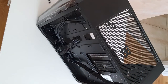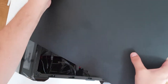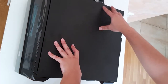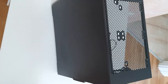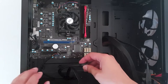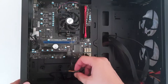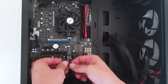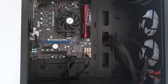Let me know in the comments if you can see anything. Let's put the back side panel on — I got this case for 35 bucks just because of this dot on the glass, looked like a good deal. Put the screws back. Now we need to connect all the front panel connectors: USB, audio, and the front panel pins — those are the most difficult part because the motherboard doesn't label them, so I need the manual.